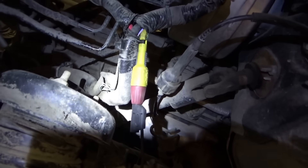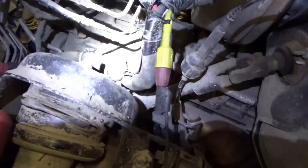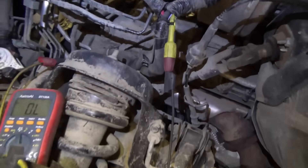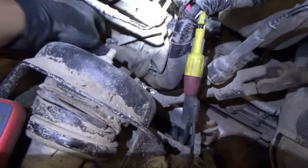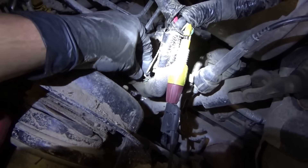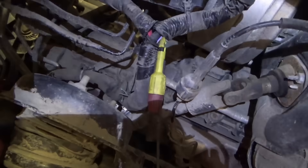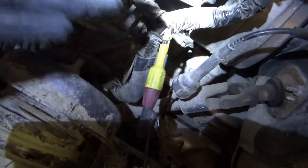Why did this happen? Variety of reasons. This truck lives on a dirt road, so mud and dust pack into the harness and it becomes like sandpaper. There are also suspension modifications — this harness was not attached to the shock tower, so it's bouncing around and rubbing the wire through, creating a pinhole. If it's biased positive, the green crusties take over. This thing is soaked in salt all winter long. So let's fix that wire, tape everything back up, and this truck should be back on the road.